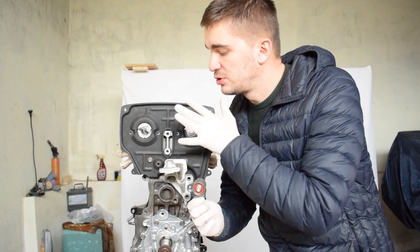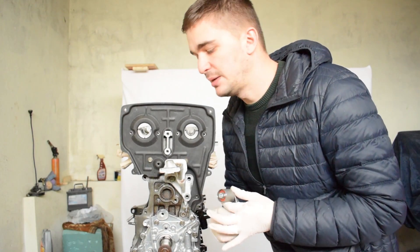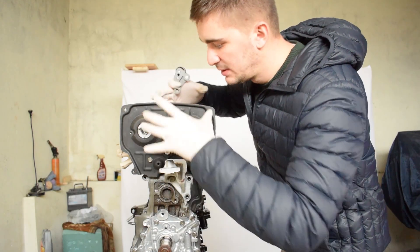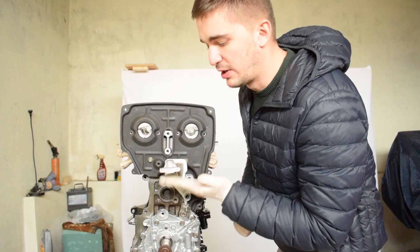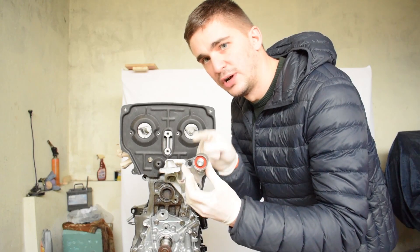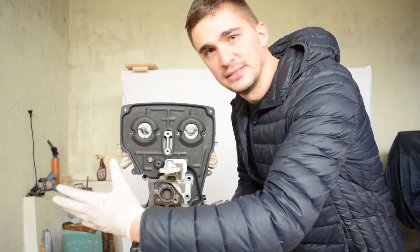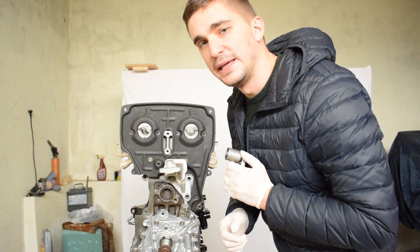But first, a quick note before I show you how to modify the backing plate and the timing cover to fit your MRP Cam Belt Stabilizer. The note has to do with the placement of the 4AG engine inside your engine bay. In the case of my MR2, the 4AG is placed transversely, which is why it has this big engine mounting bracket right here. If that's the case with your engine, you need to order the front wheel drive version of the MRP Cam Belt Stabilizer. If the 4AG inside your car is placed longitudinally, like for example in the AE86, the Hachiroku, you need to order the rear wheel drive version of the MRP Cam Belt Stabilizer.